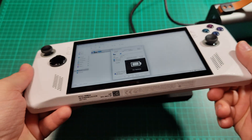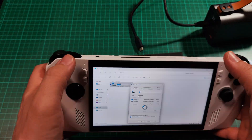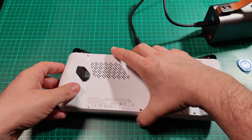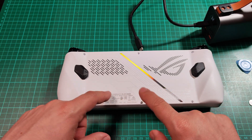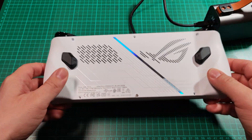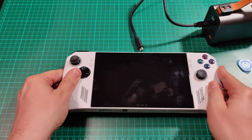And as simple as that you have migrated to a larger SSD drive — no drama there. All you have to do now is put the back screws on: the one with the washer that you cannot put in another place, and the five other ones, and you are done with this. So be sure to follow my next uploads — and until then, see you and bye bye.